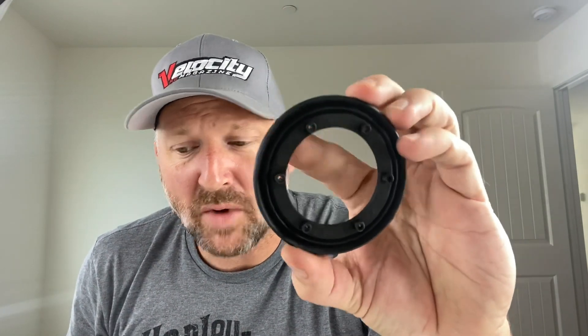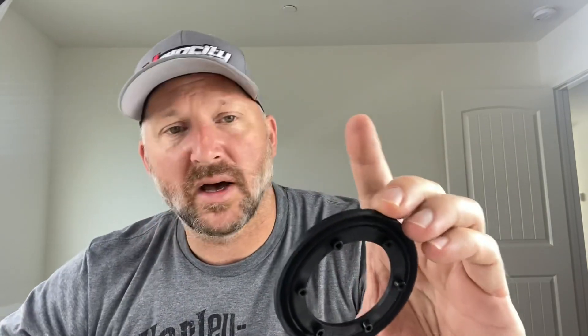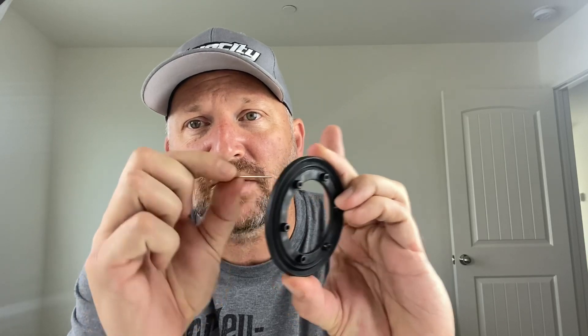The easiest way to figure out the outer ring is that the screw goes into it — so the outer ring is very easy to find. The inner ring is where the hex is going to be. The small holes take a 1.5 millimeter wrench, which is an alignment tool in tech terms. A 1.5 millimeter wrench, or whatever you have small enough, will help you align and save you time.